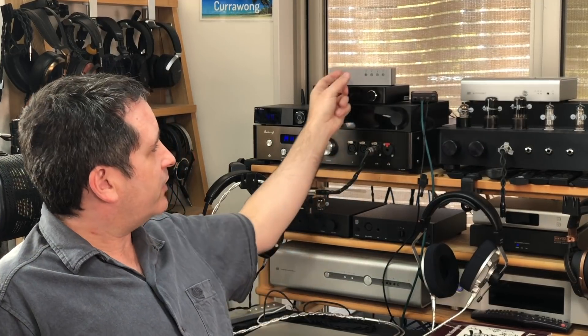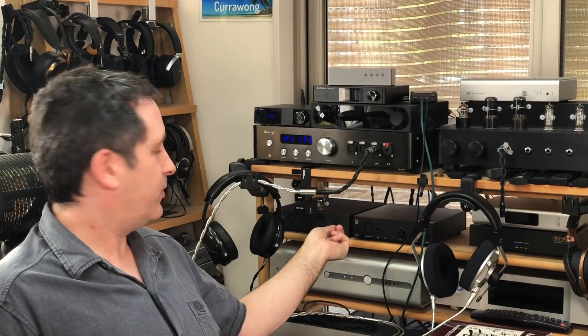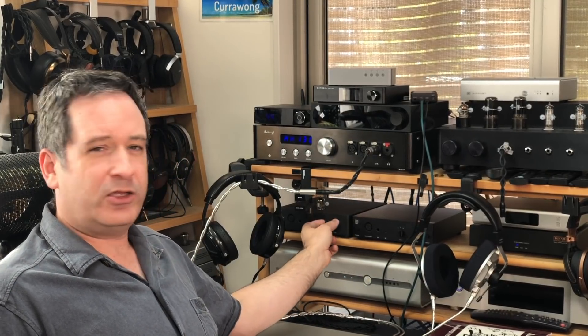These DACs can sound a little sharp and sometimes too clear. I recommend pairing them with something like the Covelli tube hybrid. You're only going to be using the single-ended output of the DAC in that case, and the difference is going to be very small. The slightly euphonic sound of the tube amp, even if it doesn't measure quite as well, will probably balance things out nicely for a very pleasant, simple listening combination. If you have active speakers with balanced inputs, use balanced for long cable runs to avoid noise pickup.